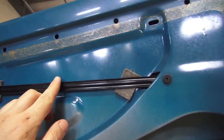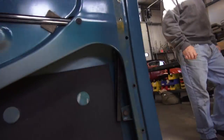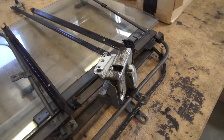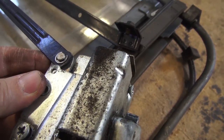You've got this bar, and the latch goes in first — screw that latch down on the outside part of the door, then you have that bar. The glass goes in afterwards and slips right in just the way we took it out. When you take out the latch, make sure you put all the hardware back, put the E-clip back on to keep the arms together, and label everything.